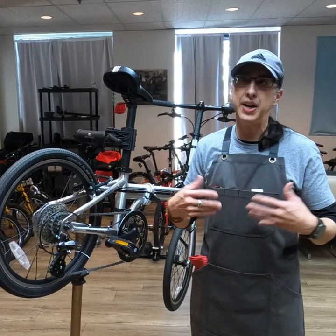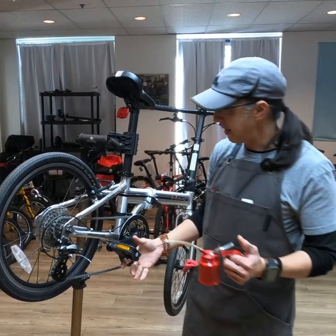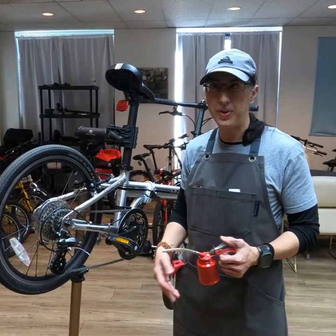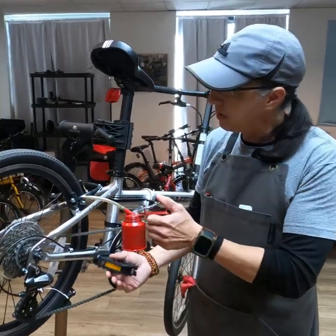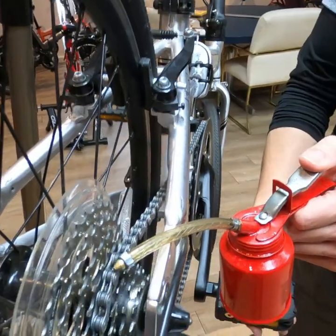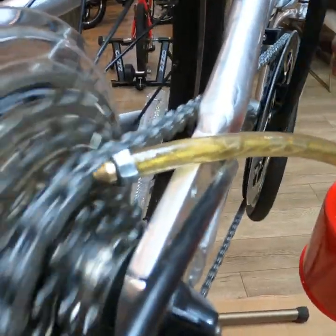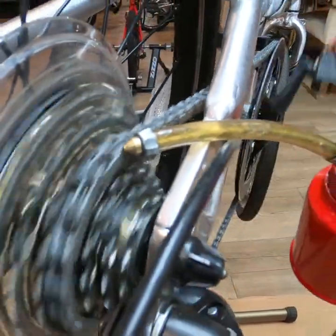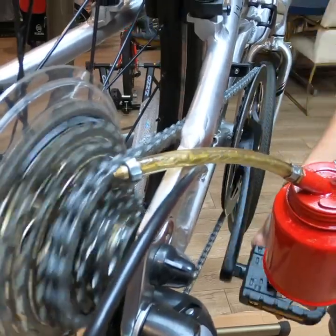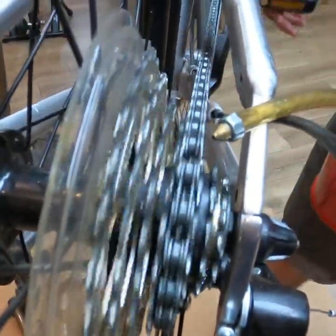This isn't going to be an in-depth degreasing or anything like that. The lubricant we use at our shop is a wet lubricant — it seems to work out best, but whatever lubricant works best for you in your area is fine. Wet or dry lube doesn't matter. I've got my oil in a little applicator and I'm just going to place the tip here and squirt oil on while pedaling — just getting the chain nice and drippy, getting a lot of oil on as I'm pedaling and it's snaking its way through.